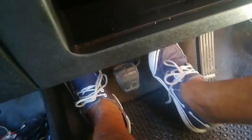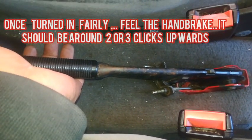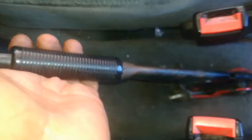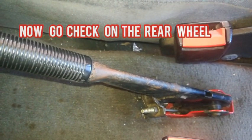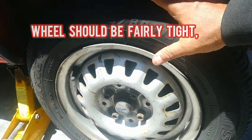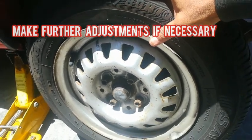Now we come to the handbrake. Put on your first nut — the one that you took off — just put it in by hand, and now you're going to actually tighten it up. You're going to turn and turn and turn. Now you've tightened in the nut, and you can proceed to pull up your handbrake. See, it's just two clicks. Now we go back to the rear wheel — you can see I'm trying to move the wheel, it's moving a little bit but it's very tight. You can make a few more adjustments tighter at the handbrake. You can see the handbrake has adjusted.